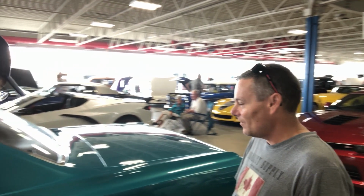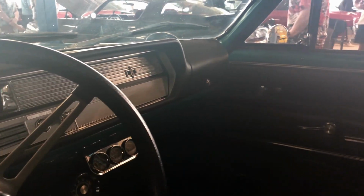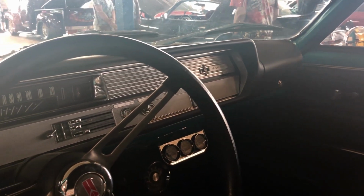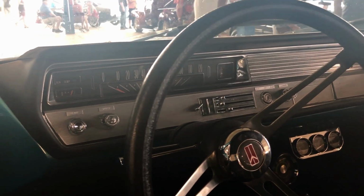Yeah, wonderful. So the interior, you said wasn't stock. No, the dash and everything is. Bought new panels for it, so you can't really re-vinyl them. Yep. So the console I found, somebody had a seat can that was getting rid of all the Oldsmobile parts. So I found the console in there. It's been hard finding an original shifter. I did find a couple, but nobody knew how to take the pins out, so they always broke the rabbit ears on it. So I ended up having to switch it to a B&M. Just too hard to find an original one in good shape.